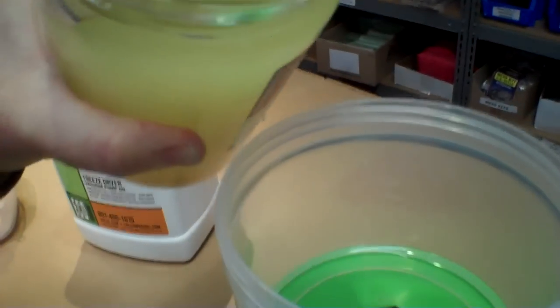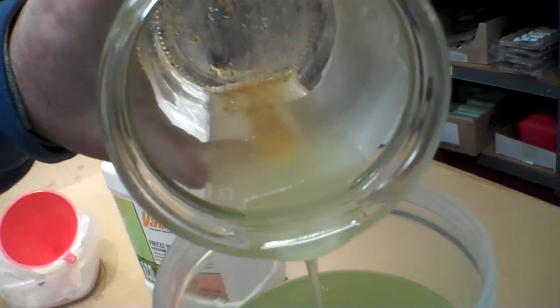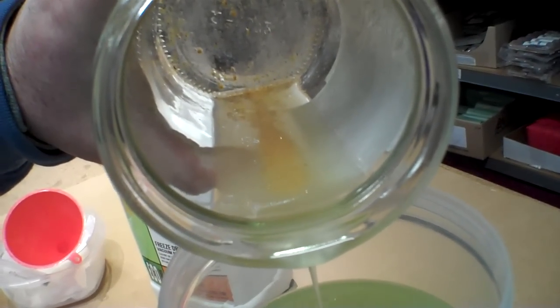Some people put the drained oil in the freezer — it makes the oil very thick and freezes the water in the bottom so debris attaches to it. I've found that's not really necessary when you have one of these filters, especially because the lip on the container makes it easy to stop pouring before the water goes in. Now I'm going to go ahead and start putting this in the Harvey filter. You can see the water starting to come to the edge here, so we're going to stop before that happens.